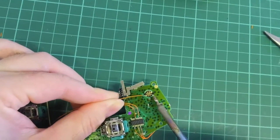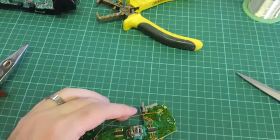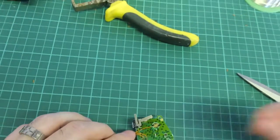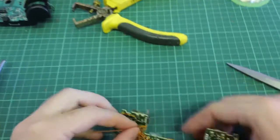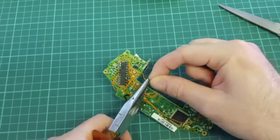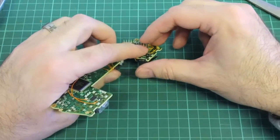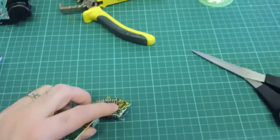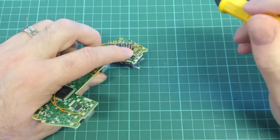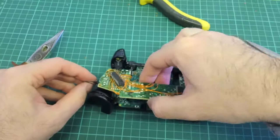Now once we connect this one, that's the last connection before we can put our board back in. That's all the connections from this board. Now we can bring the plastic housing back over and pop our board back in. Get it back in line — use the connector at the bottom as a guide. We're going to plug those plugs back into the sockets on the other half of the board. Just give it a bit of a squeeze down and you'll see it goes nice and flat. Once it's flat, you know those plugs are pushed back in.